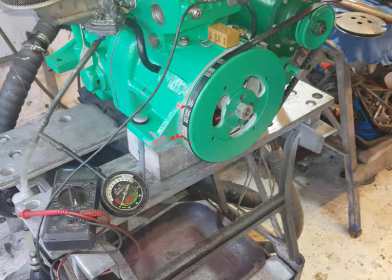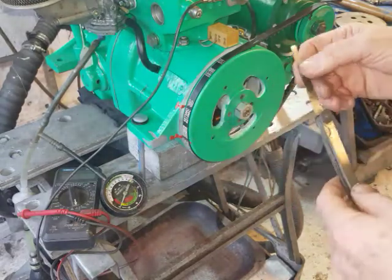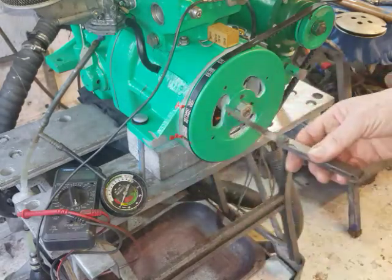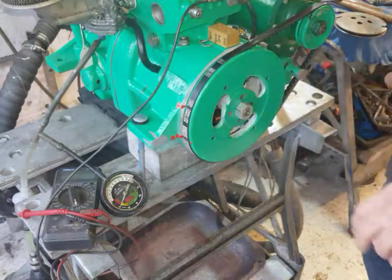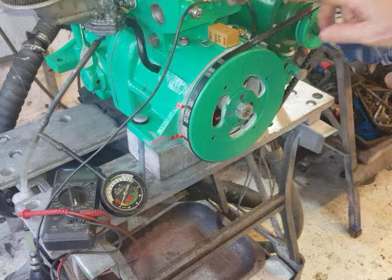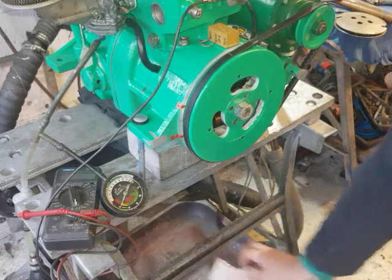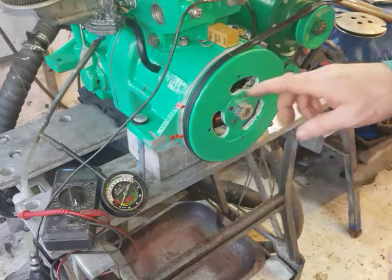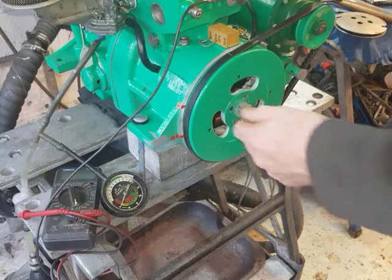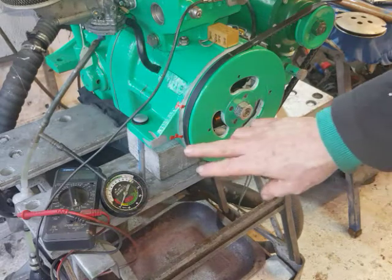When you've got it exactly at the right firing point, do the three screws back up and check again. That's a really simple, non-invasive way of setting or checking your timing. I'm assuming your points are set at the correct gap — if not it will put the timing out a little bit. Use a feeler gauge and check that it's 17 thousandths of an inch, plus or minus one thousandth. Before you close up the engine, make sure you've got a spark by spinning it over. If you can't see a spark, clean the points — you may have dirtied them with the feeler gauge. Just put a piece of paper or cardboard between the faces and pull it out, then snap the points against the spring.